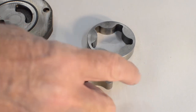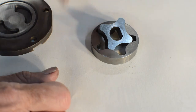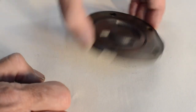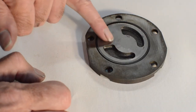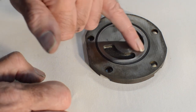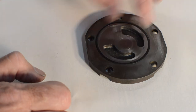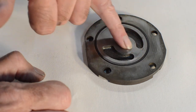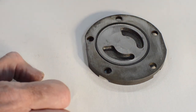So it's going to go back together, which we will do shortly - once the case halves are done I'll show you that going back together. And there is a pump outer cover which I've cleaned up. Again you're looking for scoring or gouging around here, because if there's lots of end float on the pump it'll grind away and hammer at that surface. But again, very very minor marking - I've got absolutely no hesitation in using this again.